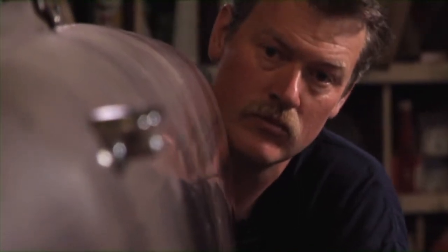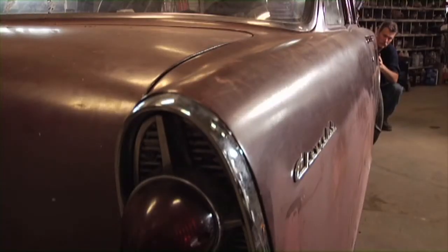Rust is what's going to kill these cars. One of the tricks is to sight down the fenders and see how straight they are — if they're a little bit wavy, that's an indication that there's been some body work done. Whether it's good or bad you don't know until you start stripping paint. Wavy isn't necessarily bad; it depends on your standards for the finished product and how far you're willing to go to repair those waves. It's just time, money, or both.